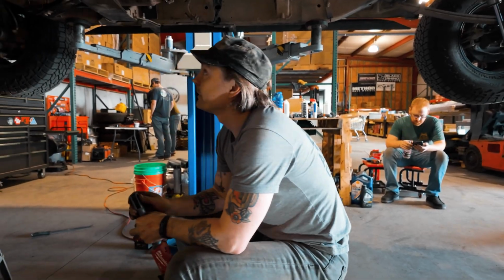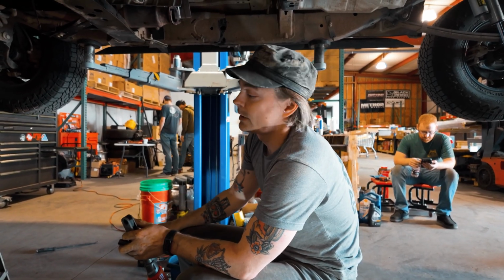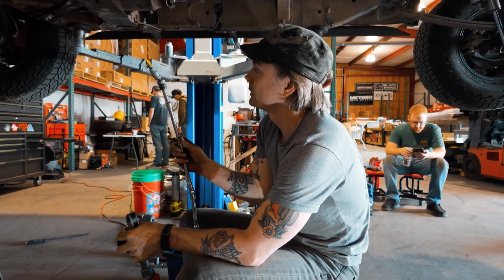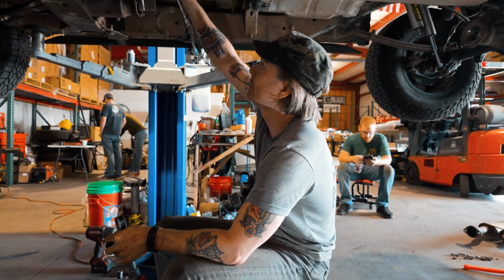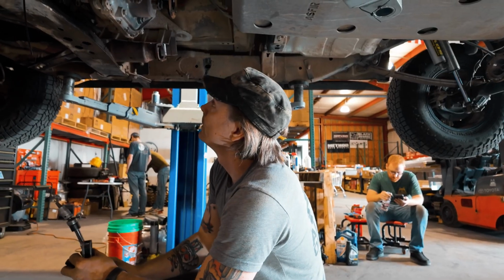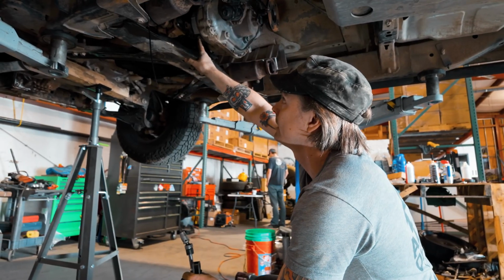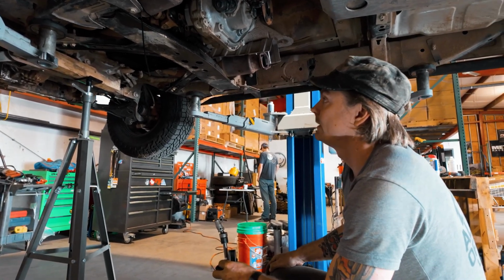So we actually got all of the Torx bolts loose right now. There are some really tricky ones to get to. You're gonna need a number of extensions, and 2 swivels should be enough to do it. The top left-hand one is very tricky, and then on the inside here, all but 2 of them thread in this way. There are 2 that thread in this way, and so these 2 are pretty tricky. Probably be easier if we pulled the front drive shaft, but we're just leaving it for now.